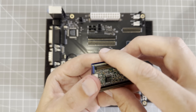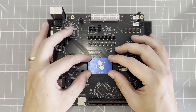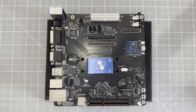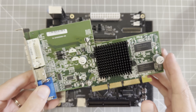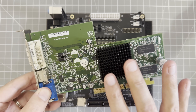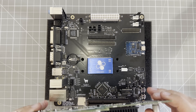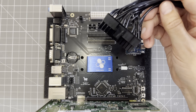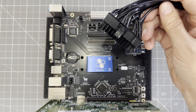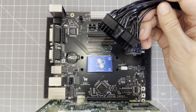The system on module has two rows of 32 pins on the back. We line them up with the board and then gently push to secure it. Next, it's time for the graphics card. I bought this new old stock Radeon 9200 SE — it's massive overkill for a system like this, but it was too cheap to resist, and most importantly it keeps my build brand new. Last but not least, it's ATX power. The board works with a regular PC power supply, and the module doesn't draw too much power, so you might get away with a Pico PSU.